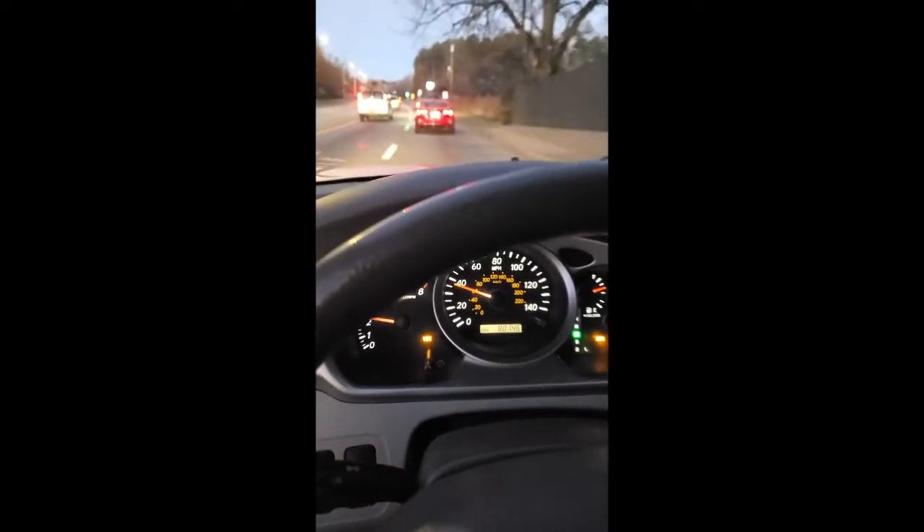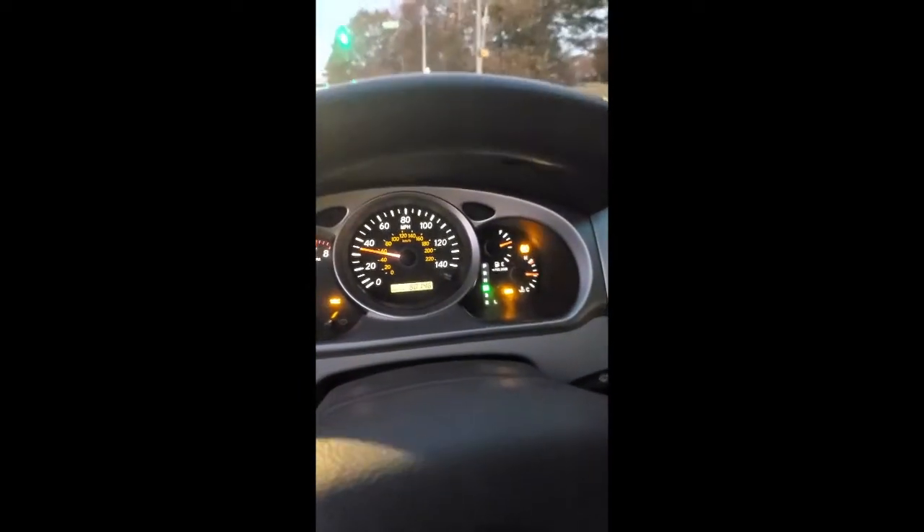That's kind of normal there. A little slipping there. Did you see that — where it went out of gear and revved up real high, and then all of a sudden went back into gear with kind of a hard punch? See right there again, because I'm going up a little hill. Anytime you get to a hill you've got to take your foot off the gas and basically just feather it up the hill, or else you'll go out of gear.